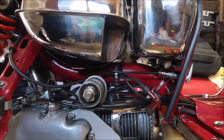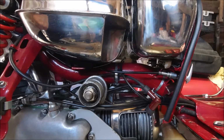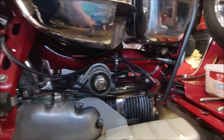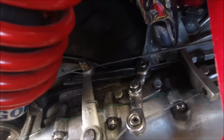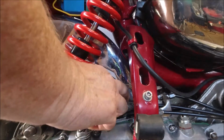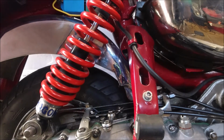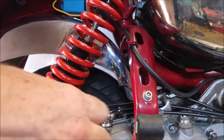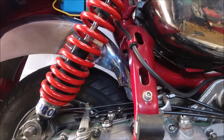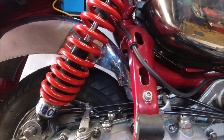Now we've got two choices with the cables. We can either take them all out and maybe put some new cables in. I mean, there is literally not a hair's breadth out of place with them. It looks like I've picked a plastic bag up in there, rolling it in yesterday. Yeah, I have. But we can unbolt the carrier and take off the rear hub and do it that way, or I can just disconnect the cables, which is probably what I'm going to do. Put some new inners in again, and I should be set for a while when I've rebuilt this engine.